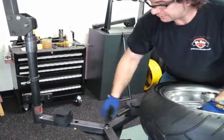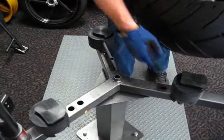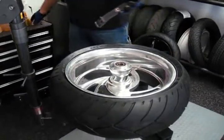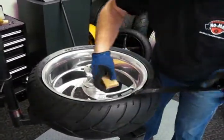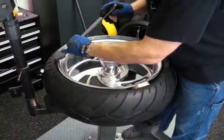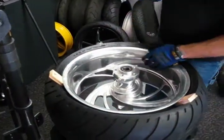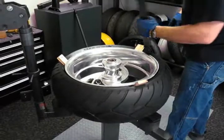The blocks don't need to be symmetrical — on this wheel they're not going to be. You can see I've got two holes here and one here and here. I'm going to pre-compress the tire. I can't get the extra hand clamps in this wheel; it's too stiff and there's not enough room. So I'm going to use a spoon bar and three wood blocks instead of the extra hand clamps. I'll position these blocks over the polyethylene blocks on the bottom, referencing them perfectly into three quadrants. All we're doing is shimming the tire down to make it easier for one person to lock into the blocks. The rim clamp set could be used to hold the wheel, but these blocks should work just fine.